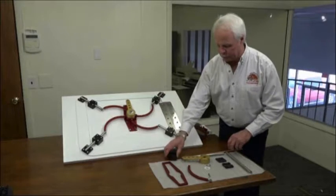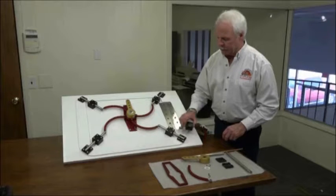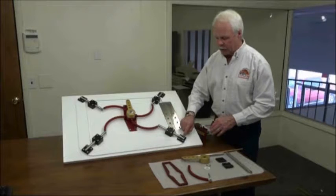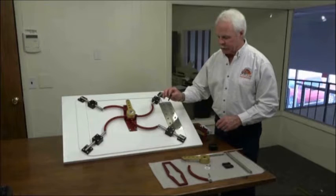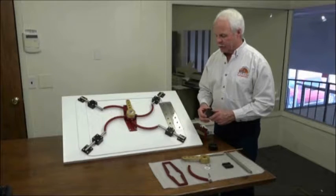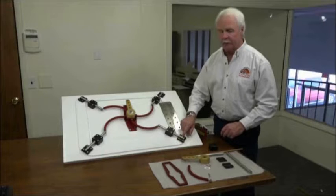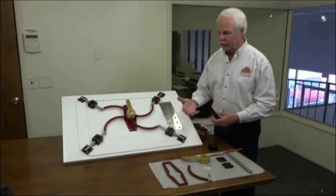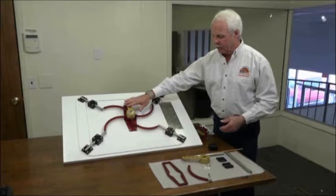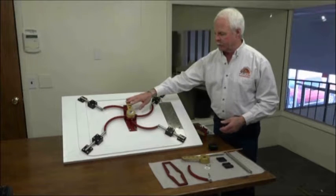Also take into account the relationship of the height of the striker block to the pillow block and the thickness of your material. You may need to shim up the pillow block or striker block — a quarter-inch shim is provided, and these can be machined to a thinner thickness or you can use aluminum or other appropriate material. Once installed, you want a moderate amount of side load on the pin so the door doesn't rattle and holds tight. You have quite a bit of leverage with the handle, so you want the door held firmly in place while racing and not have the assembly walk on you.